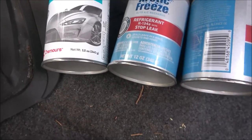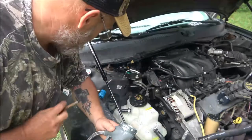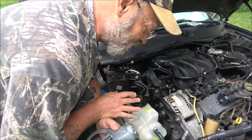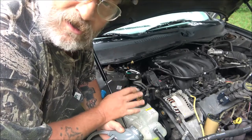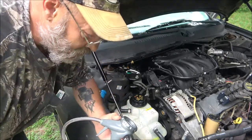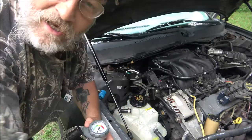I've got to get some of that out of there. I went and got my new gauge and some Freon. I removed a bunch of that out — you can hear the pump kicking on and off, that's the AC compressor. I had to remove a lot of that out of there, and hardly any refrigerant came out because it had two cans of that stop leak in it.